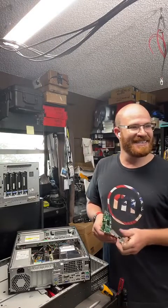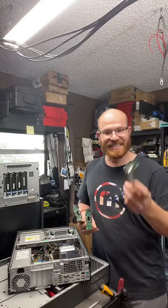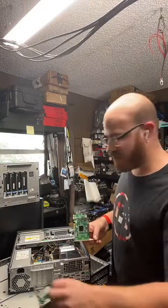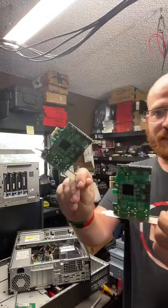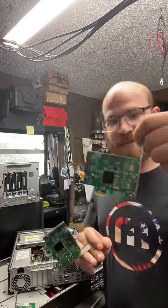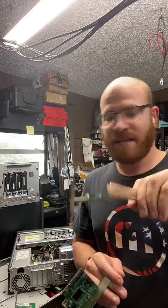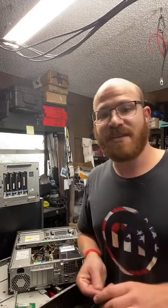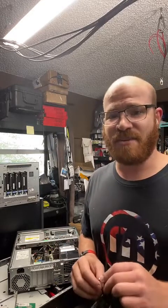I have a tiny little PCIe 1X Ethernet card that no longer works after dropping it. And then I have two PCIe 1X SATA cards, so that replaces that. I don't need SATA 6 or anything crazy. They're slim enough that if I take the full height headers off, they'll sit nicely inside of that board. The controller needs to be bootable and the motherboard's BIOS needs to support booting it — that's absolutely correct. The i7 processor in there is in the 2000 series, and I doubt I'm getting a BIOS update to support that. But I've used these exact PCIe cards in other systems and it boots just fine.